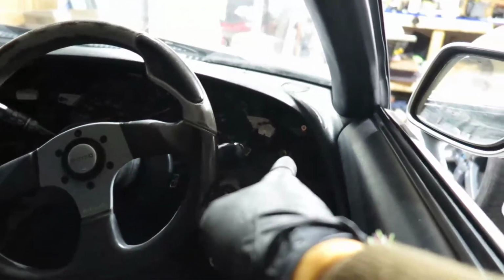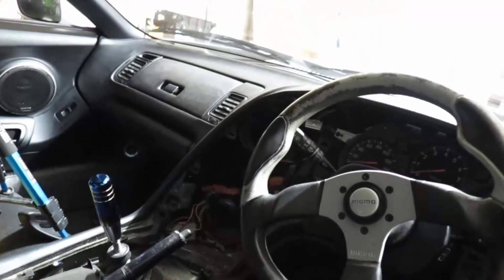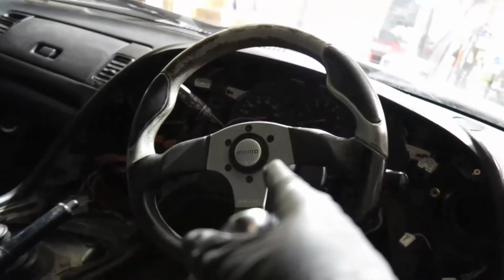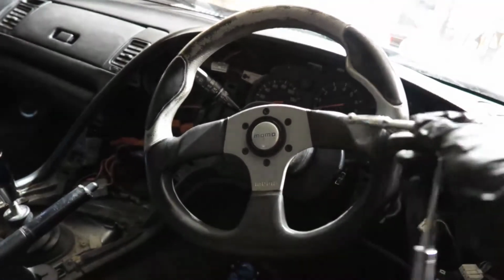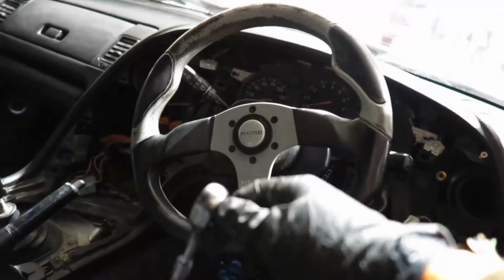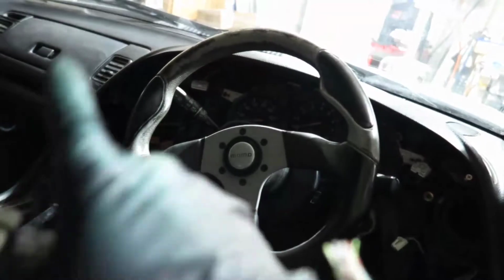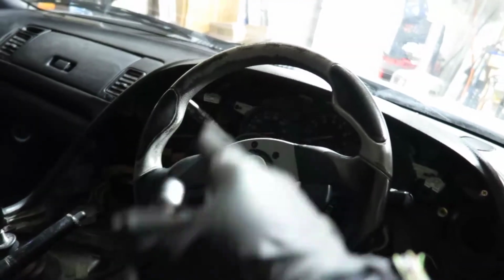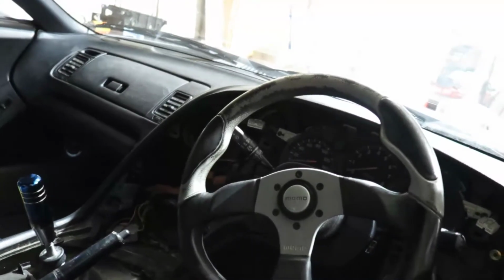There's going to be a lot of 10 millimeters here and there. Of course, the front of it. I do not expect to have any airbag because, as you see, it's turned off and the OEM steering wheel is not here, so I don't have an airbag. But basically you want to turn off the battery so you don't cause any airbag explosion and all that stuff.